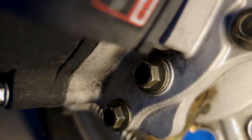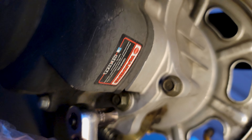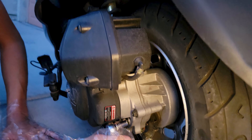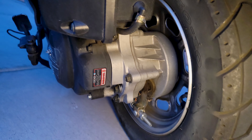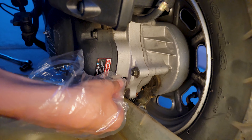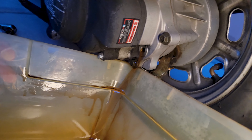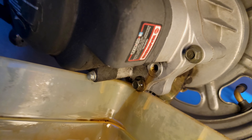There's our drain plug. We're going to open the gear oil fill first. It's the one right in the middle — it's got a double-8 on it and a washer on the side. We're going to go the other way to loosen it. So we cracked it loose and some drained out. We also have the main drain bolt — same 17mm — and a little bit more came out. Now I'll tip it over. About 8.3 ounces, which is 250 milliliters. The spec I found calls for 0.25 liter — basically a cup of gear oil.